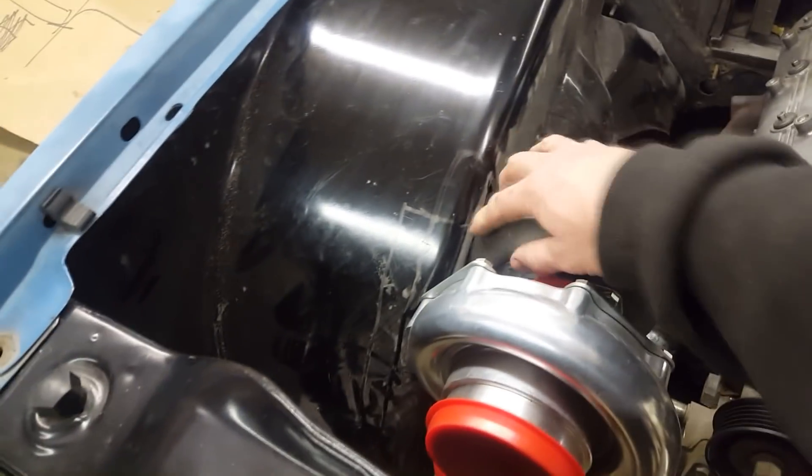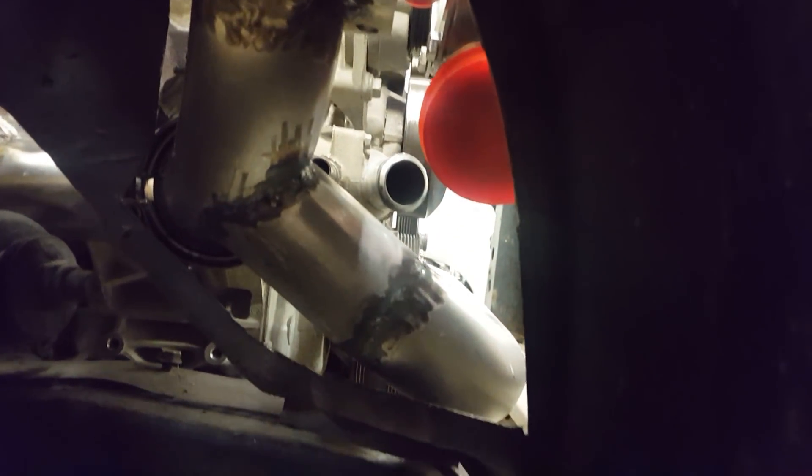As you can see I had to cut — I'm still going to cut a little bit more, but it's actually not too bad. You can see how much I had to cut out for clearance, and there you can also see how the hot side connects up. Today I'm going to do the wastegate placement, maybe get started on the exhaust too. We'll see how much time I have, so stay tuned.